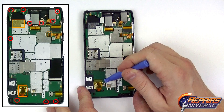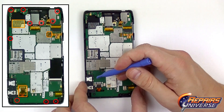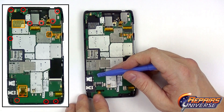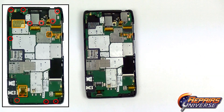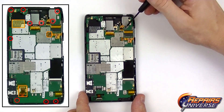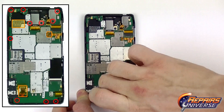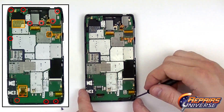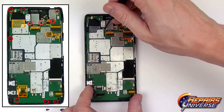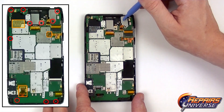Focusing back on the motherboard now — we're going to release this bottom connection which is your battery. It's always smart to release the power source first, so we're just going to remove that tape, use your Safe Open Pry Tool and lift up on that battery connection, and move it to the side. Now the battery is fully disconnected. We're going to use our Torx T5 screwdriver and release the 10 T5 screws located throughout the motherboard, as shown in the diagram. All these screws will be the same size so you can put them in a pile without worrying about mixing them up. With all the screws removed we just have a few connections to release.